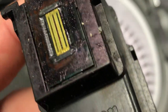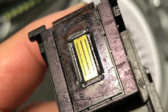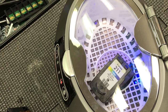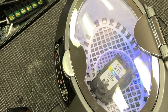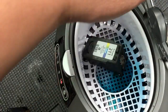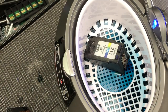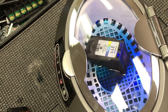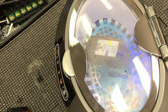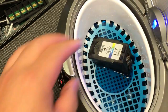You might not always be able to see the clog. For example, this Canon printer — they look okay, but when we put them in the cleaner, you can see only the blue, the cyan, comes out. When we lift it up, you can see a tiny bit of yellow, so we probably will not have magenta. Adding a little more cleaning solution — you can see a little bit of black now. The color coming out should be black, because if you have equal parts of cyan, magenta, and yellow, they mix together and become black.